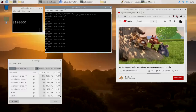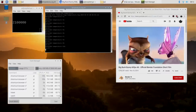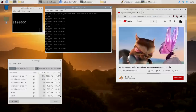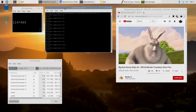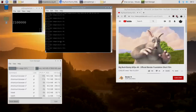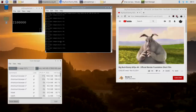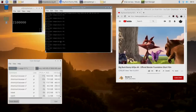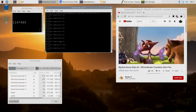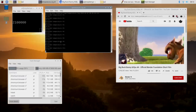Now it's time to get into some testing. I'm going to run this at an overclock of 2.1 GHz and also test it at the stock clocks of 1.5 GHz, facing it off against the Flirc case. I'll run idle temperatures, 720p YouTube video playback, temps while extracting an image, and then an extreme test that maxes out all four cores for 20 minutes straight. I'll leave a log running in the background, make up some charts, and we'll be back in a sec.